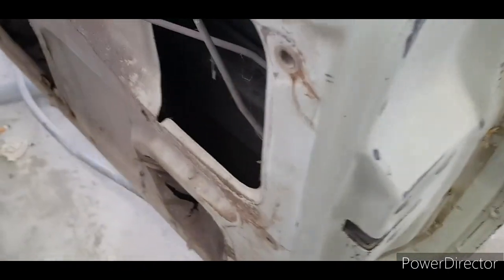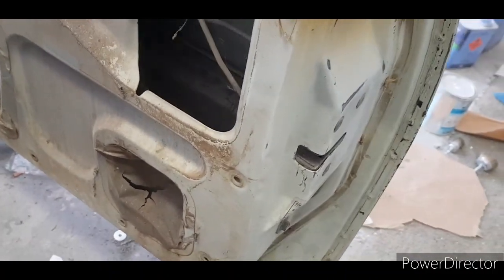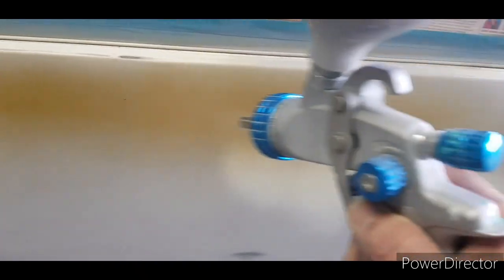And what I'm going to do is, as I said, it's going to go through the doors, because you might as well make it look sick, eh, mate? Oh, this door open. I haven't primed any of this, so I'll end up making sure all that is covered. I do need a mask in here, but I haven't done it yet. I'm spraying quite a big area because I want to make sure I don't miss anything. So it'll take a few coats. As I said, I've made it quite thin, because it's metallic. You can tell I made it thin because it's starting to wax up. So what I might do is actually put this down, and make it a little bit thicker.